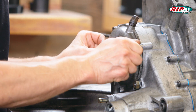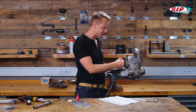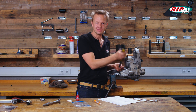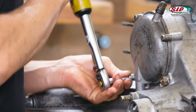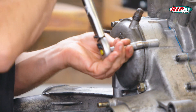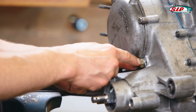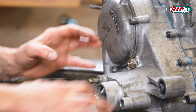With these small M6 screws, be very careful because the thread is easily worn. The factory suggestion is only six Newton meters, which is almost nothing. You might laugh at using a torque wrench here, but once you've ruined your first threads you'll start to rethink it. Now we can fold the securing washer to the secondary shaft nut, and after that we can start the brake assembly.